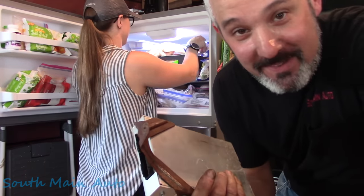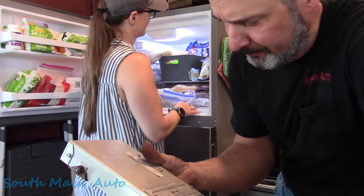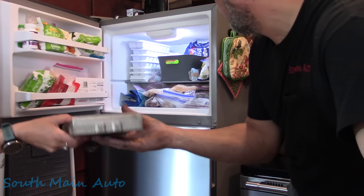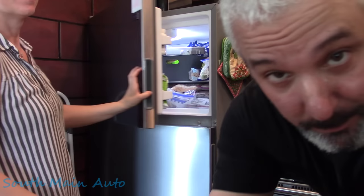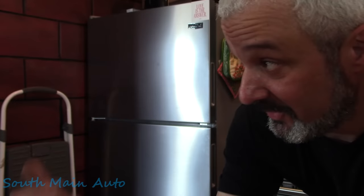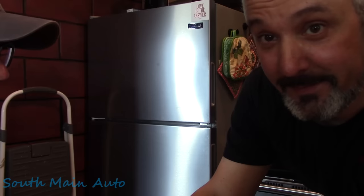We're gonna stick the old PCM in the freezer. She's pretty toasty right now. We're gonna cool it down, see if it fixes it. It's gonna be easier than circuit testing. Can you put that in here, please? Wherever you'd like it. And then, what's that gonna prove, Erico? Because time has just passed. Well, what we're gonna do is we're gonna put it in. If it runs great, we're gonna be like, oh wow, it runs great. And then we're just gonna leave it idling over here in the shop, and we're gonna get the blow dryer.